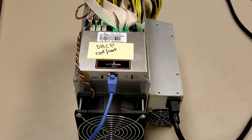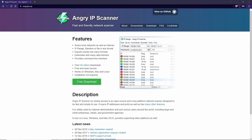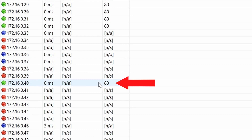Now that our machine has been reset, let's plug it into our network and get the software set. There are a couple of ways to identify where on your network this machine is located. If you're familiar with logging into your router settings, you may be able to find the IP address assigned to the ASIC that way. Another quick and easy way is to use a network scanning tool like Angry IP Scanner, a free program that will scan your network and identify IP addresses where devices are located. The IP address for your miner should show up in green with a free port of port 80.